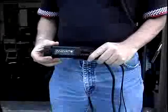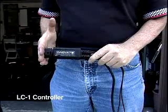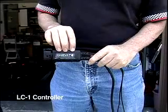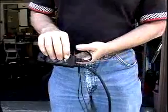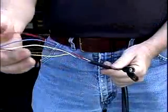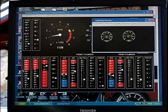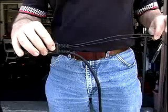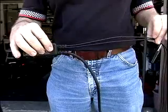The LC1 controller itself has a connector that allows you to connect to the wideband O2 sensor, and a body that encloses the internal electronics. It has three cables: the large cable is the wiring pigtail, which can be cut to length for any bike. The two additional wires are computer communications cables used to program the LC1 or read air fuel ratios. If you have pre-programmed LC1s, you won't need to use those unless you want to change the programming later.